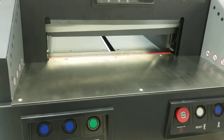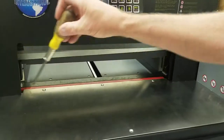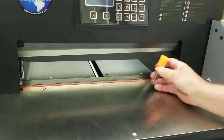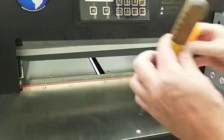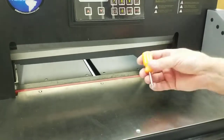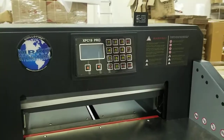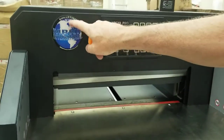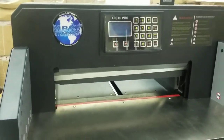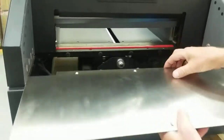It's basically an electronics compartment cover. You just need a flat screwdriver — I've already removed it to make this faster. It may be easier with a short screwdriver for the screw closest to the blade because the angle is tight. If you can't get it, you can take the crown off — there are just two screws on each side, it pulls off, and there's one cable to unplug. Typically you can do this leaving the crown on. Slide the cover forward and set it to the side.